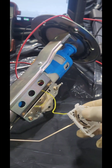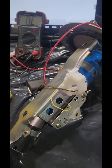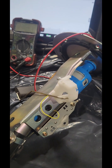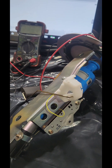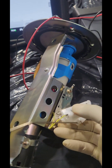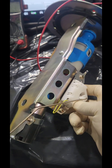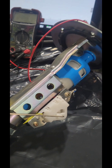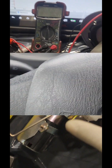You can buy just the sensor and throw it right in there, hook the wires up — but when you take it out, test the pump too. Make sure you're getting around 50 PSI — this is not a GDI pump, so it won't put out 1500 PSI, it should do around 40 to 55 PSI. This one was putting out about 42, still good. But we're not going to just replace the sensor — we're replacing the whole thing. We don't want to take chances: put in just a sensor, then the pump goes bad and we have to drop the tank again. That's way too much work.